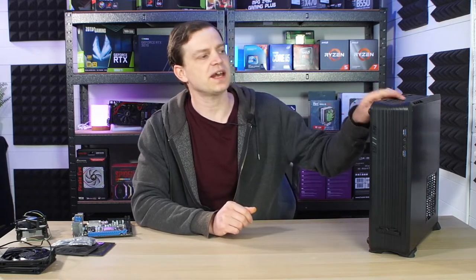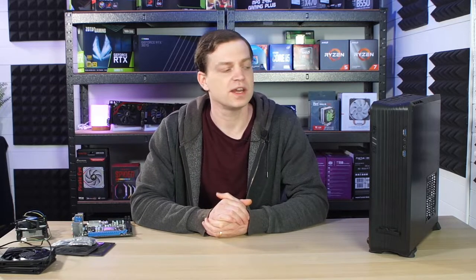One of the bonuses with this case is that they do two versions. One version you actually have to have an SFX power supply because they give you space for an extra 3.5 inch hard drive and it also comes with a DVD-ROM slot. This one though is the version that doesn't. We can actually fit a normal standard size ATX power supply, which is a bonus for us because it means we don't have to buy another one, and we don't have to worry about floppy drives or things like that because our system has a SATA drive and we don't actually use CD drives at all, which is going to make this build super easy to do.